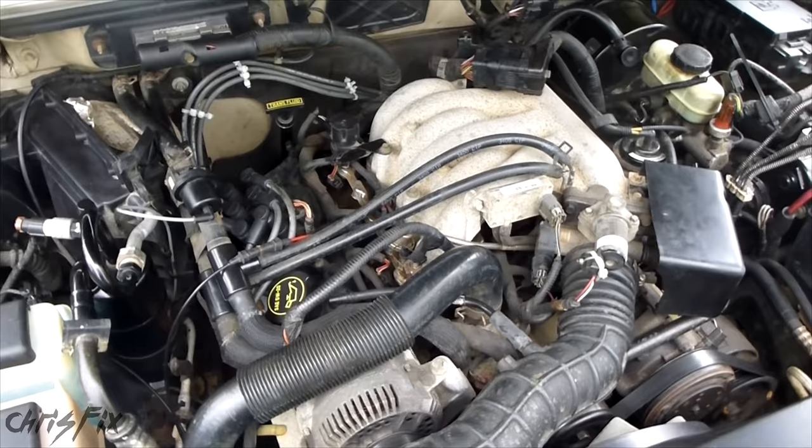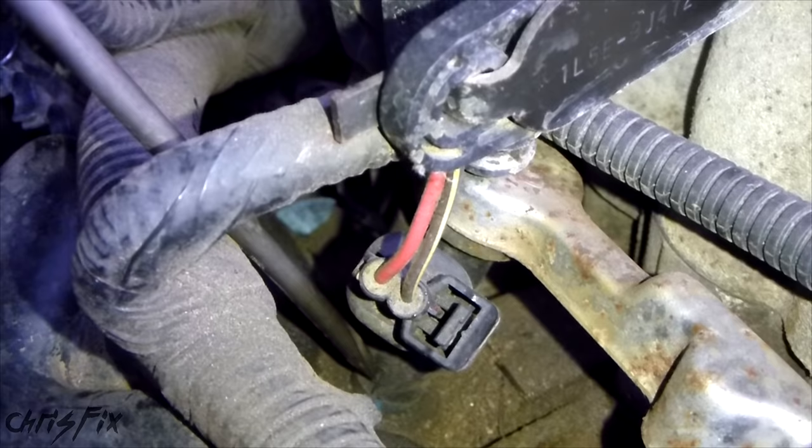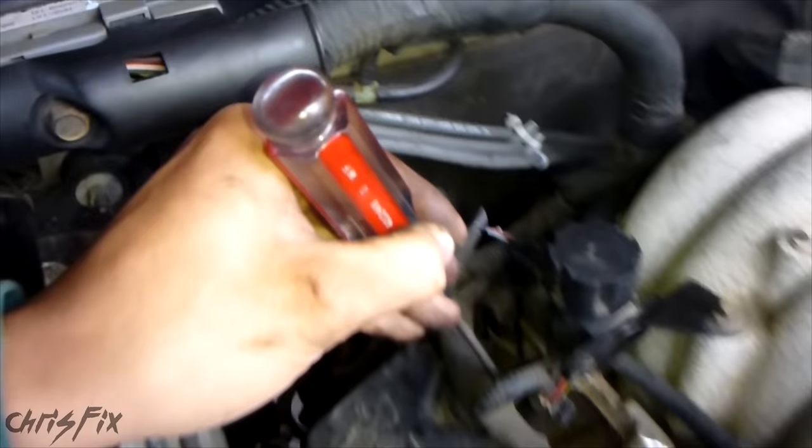In most cars the fuel injector is going to be located on top of the engine. We can see here on my Mazda B3000 there's the fuel rail and it goes into three fuel injectors on this side. What we're going to do is grab our long screwdriver and put the end of the screwdriver against the back of the fuel injector just like that, and then you put your ear up against the other end of the screwdriver.